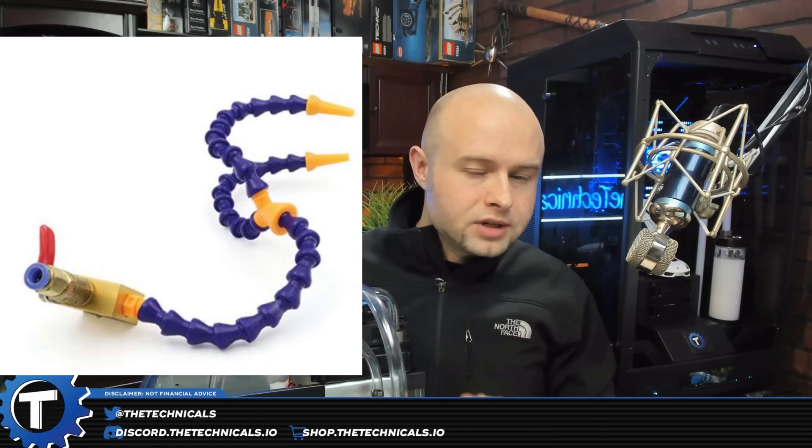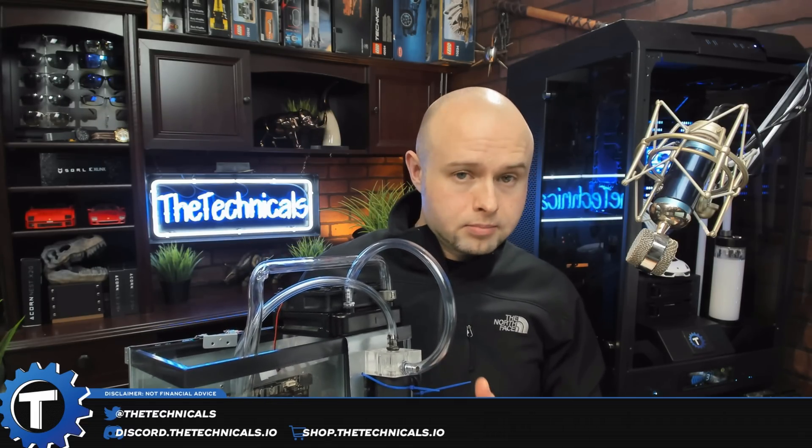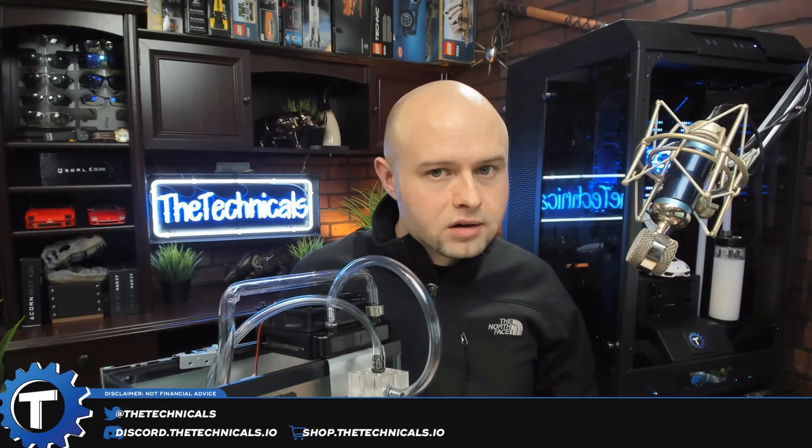On the other side we've got our motherboard. I don't know where I'm gonna put a power supply. Cables — I forgot cables are gonna make it so ugly. So again, this wasn't actually designed to work on the first go, although the size of this aquarium is perfect for a single card and would also limit the amount of coolant you actually have to purchase. Because if you're using 3M Novec or one of these other engineered fluids made for immersion cooling, they can get really expensive — hundreds of dollars per liter or gallon. Not just mineral oil. If you've got a four-thousand-dollar FPGA, you probably want to use a purpose-built engineered fluid for it.